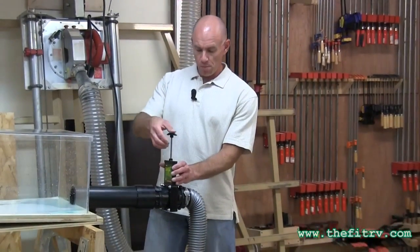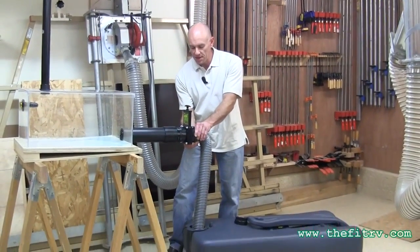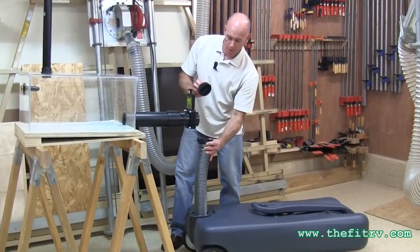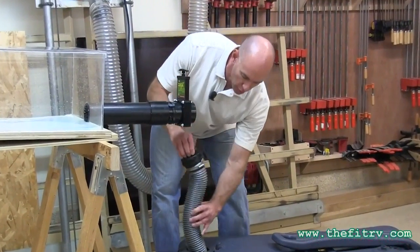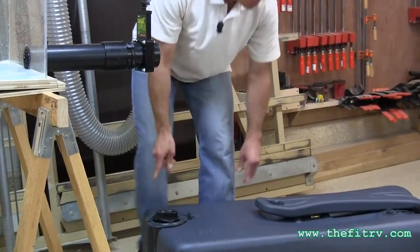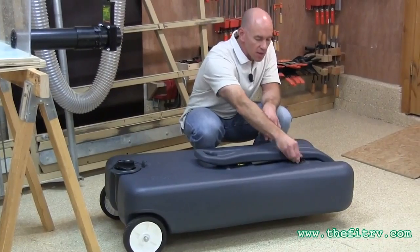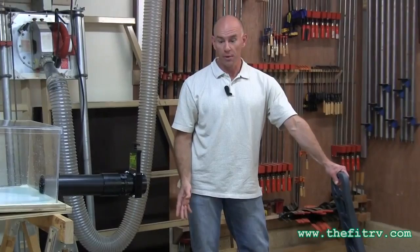Okay, and now that that's slowed to a trickle, close the dump valve. Disconnect. Caught all the water. Reattach the hose cap. Store the hose back into the Smart Tote. Now over here we're going to reattach the vent. And we're done. Tank's emptied and we're ready to head to the dump — or in my case, the sewer clean-out.